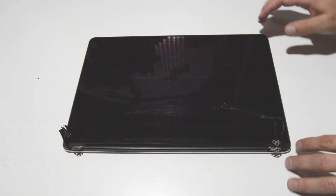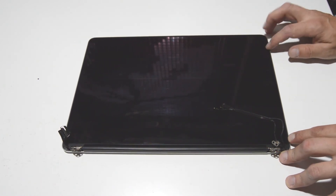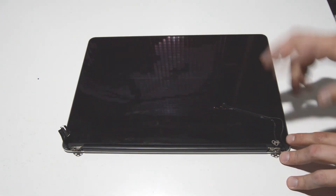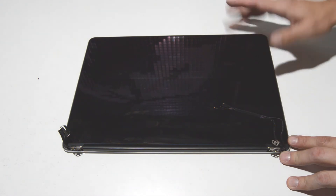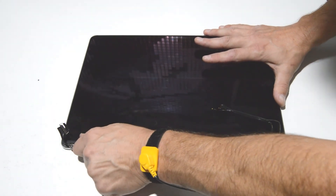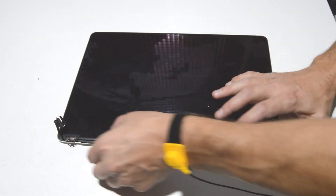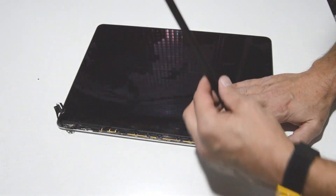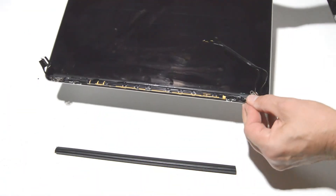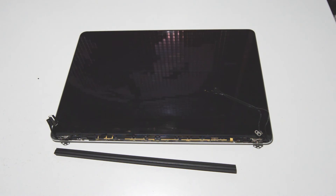For the display, we're going to keep it intact. These things are a real pain to separate, and especially on this model, a complete display assembly is definitely the way to go. But if you're having problems with your hinges being loose, which does tend to happen, you can just pull your clutch cover over to the right, and once it hits the hinge, pull up on it and it will just pop off. Then you have some larger Torx screws holding those hinges on — if they're loose, it's easy to tighten those and get rid of any annoying wiggle.